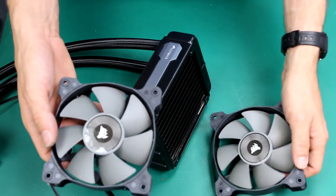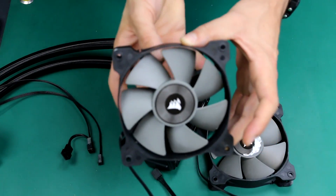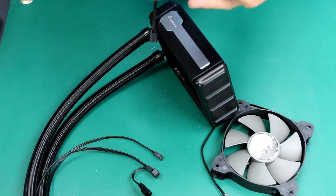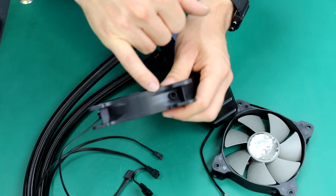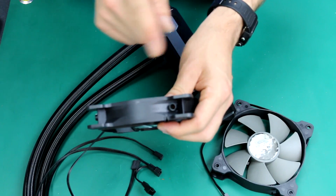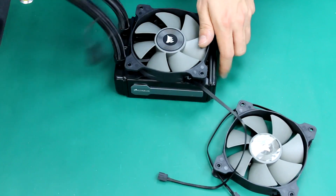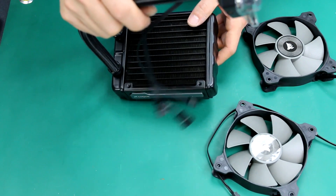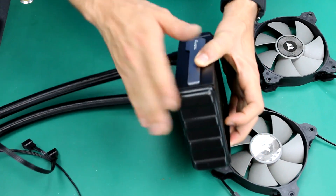We have fans here. This fan will spin and blow air in a specific direction — grabbing air from the front and pushing it outside. We want the air to be pushed onto the radiator. If you are not sure which way the fan is spinning, there are arrows on the fan that tell you which way it spins and which direction the air is blowing. I would suggest installing one of the two fans before you install the radiator or liquid cooling on your motherboard, because sometimes spaces inside the case are narrow.